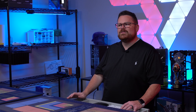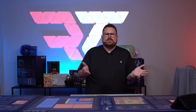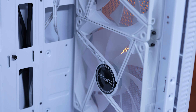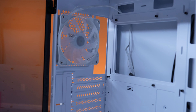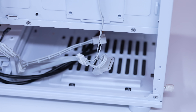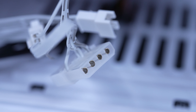Spoiler alert — we would have loved to show the fans off, but the LEDs didn't work out of the box. Antec doesn't really have much documentation on this, nor do they sell any replacement 140mm ARGB fans. So after our build and testing, we had to swap out all the fans, because you have to have matching and working fans. And the 120mm fan is like the key to the whole thing — all of the RGB functionality runs through it. Oh, and by the way, it's Molex. The fan is Molex. Our fan's Molex cable was damaged, and because it was damaged, we got no RGB on any of the fans at all, with no way to fix it. Not something I really get, not one bit.